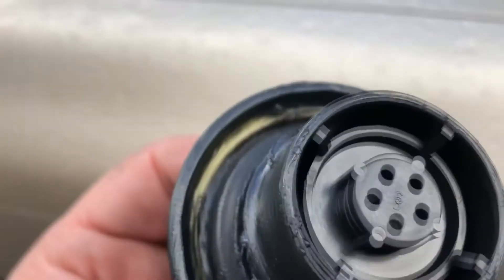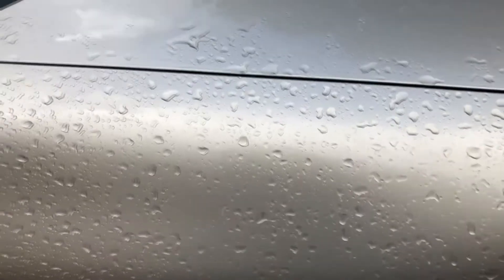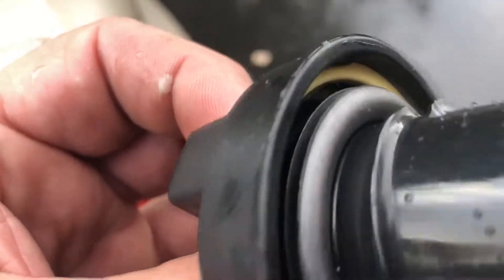I'd have to test it, but I don't have a fuel cap tester. What I'm gonna do is just go ahead and replace the cap, because there is nothing else leaking on this vehicle and my gut's telling me that's gonna fix the problem. This is the new cap — you can see it's brand new, seals in great shape, looks like a graphite seal.